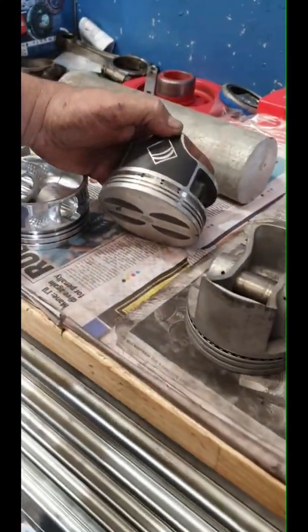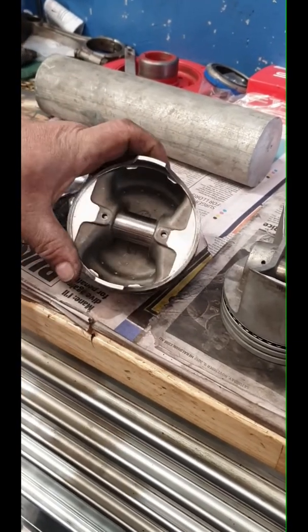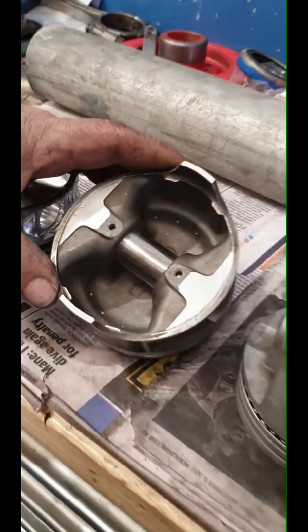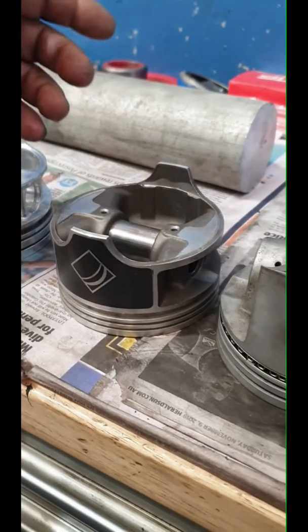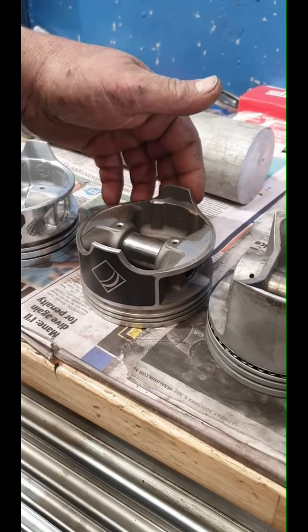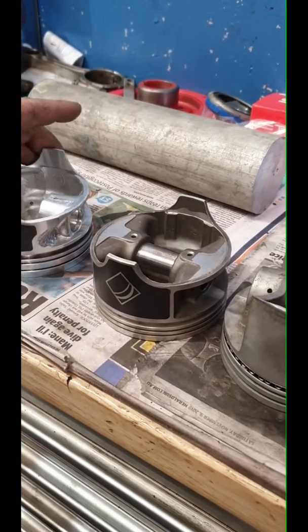This is what we call a liquid forged piston. They don't do these anymore - they weren't really a good piston in my eyes and they stopped producing them. They're called a liquid forged. Noisy - if people were doing the bore clearances a little bit too tight, they were picking up on the bore, actually grabbing on the sides. So they canned them.